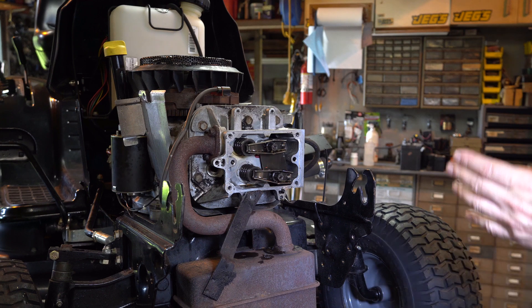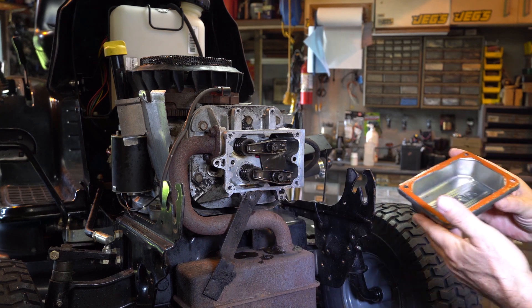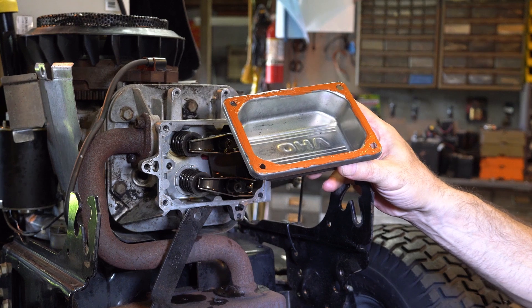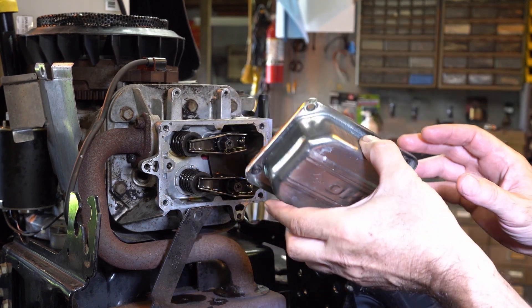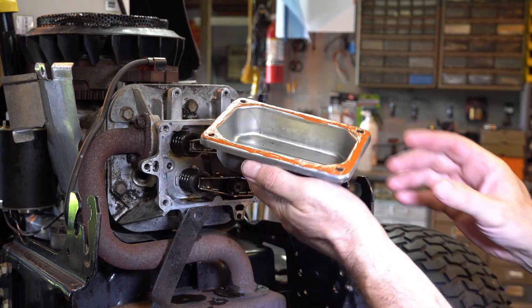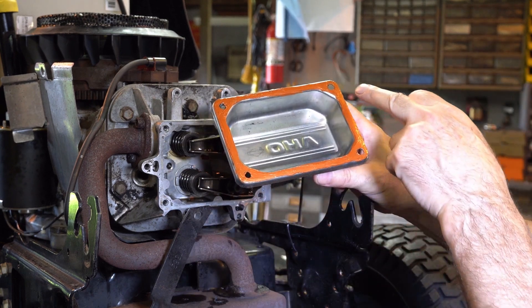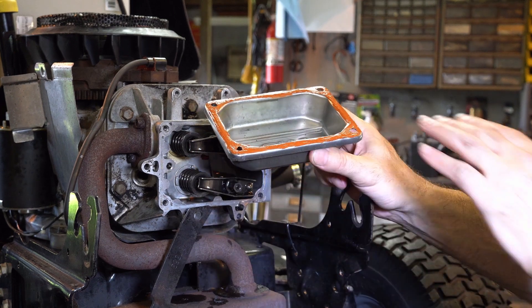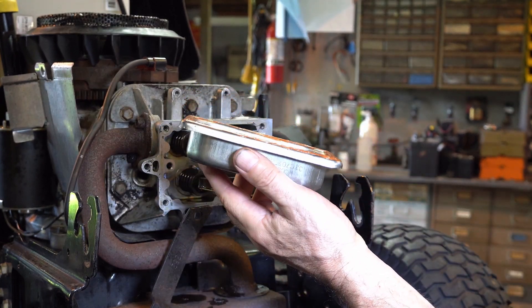I checked over the valves and I even found RTV up on the rocker arm. Here's what the valve cover looks like with just a light bead — it's been sitting and drying, it's got a skin. Without that skin you could never get a good successful seal by slapping the cover on and slamming the bolts down. Get everything super clean, lay a nice even bead with your finger, check for any translucent spots, and set it aside for about a half hour.